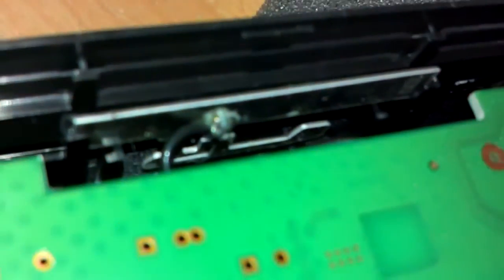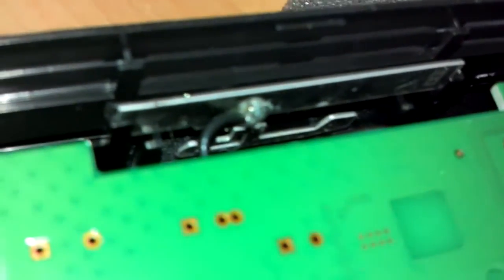After a lot of prying, the lid's now off. You can see there's one clip here at the front, another one at the side which is the bit with the hole in it, another at the back, and another on the other side. These two posts here hold the Wi-Fi antenna — a specially shaped bit of steel soldered onto the board via a flying lead. Make sure you've earthed yourself statically first.